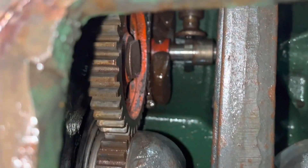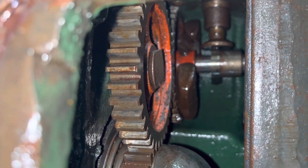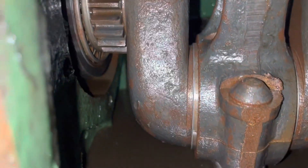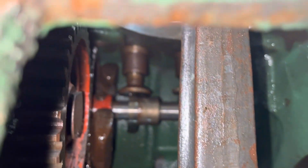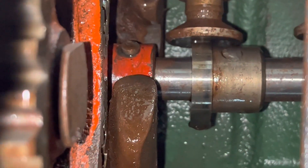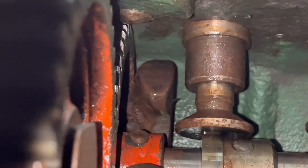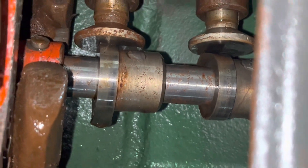There's a view inside the motor - the idle gear they call it, there it is where it's geared to the crankshaft. Well there's some corrosion for sure. Still painted the original green - there's the cam follower and the tappet, or the lifter. Yeah, everything's gonna have to come apart here and get some love before she runs.